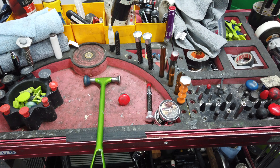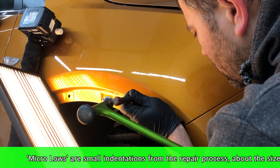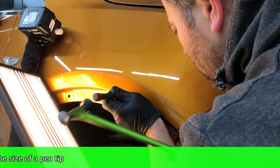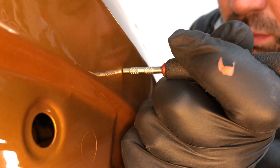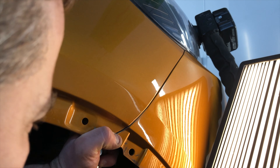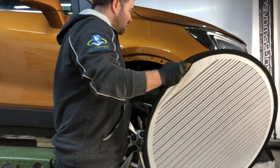I've now changed to a metal tip — I need this because I'll be pushing out micro lows and I need to be really precise. I'm also using a polished metal tip knocked down, which gives me the precision to knock small areas down without affecting the rest of it. And not forgetting this little area we spoke about earlier being kinked — because the dent has now come out the kink is hardly noticeable, so it just needs a small rectification.